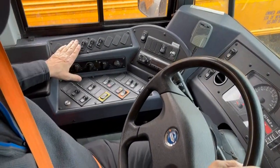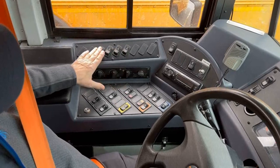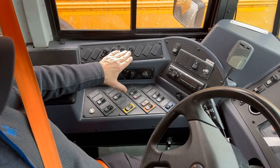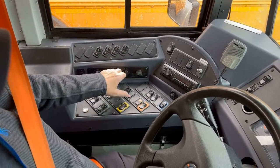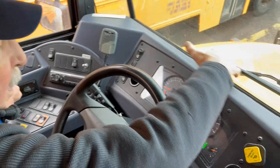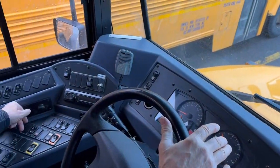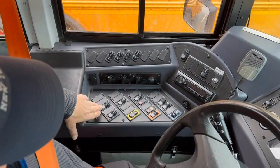We'll check our switches — we'll check each of our heater switches in turn, one at a time. All of them worked. Keeping your hand here, move straight down to the defrost switch, turn it to the right and confirm whether it's working. It is working.